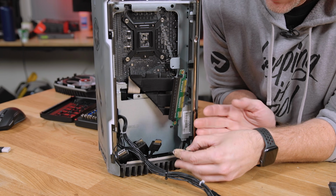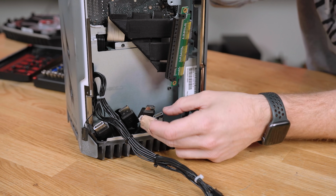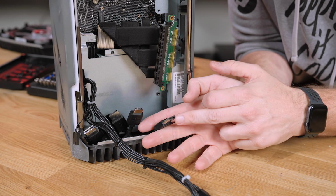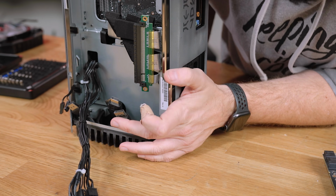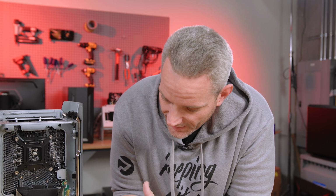We also found something out too. I want to make people aware of this, even though this system came out over a year ago. These DisplayPort riser extension cables, whatever they are, that go to this back piece here, are not high bandwidth enough to carry a 4K HDR signal at 120 hertz. Remember where that display kept turning off on us, the BFGD? We found out it was this system because these cables are not able to carry that signal.